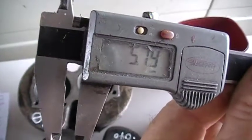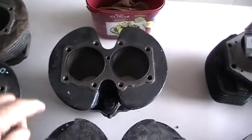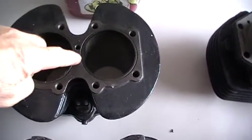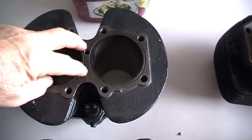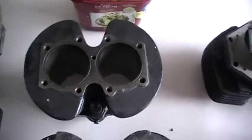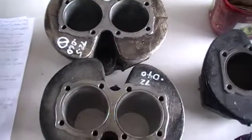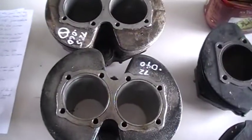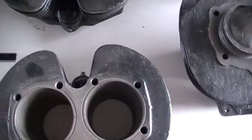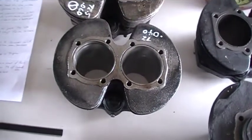That gap is quite significantly different. The nine-bolt pattern is the same as what they used on the ten-bolt, except of course the two middle ones — that's nine, and then the ten would be like there. This distance here allows for an even bigger bore than a 650 at 71 mil. These are 71 mil standard for a 650.